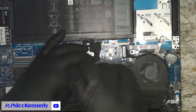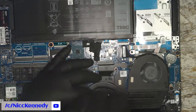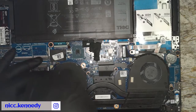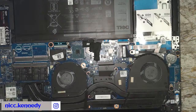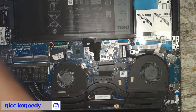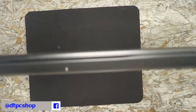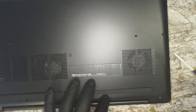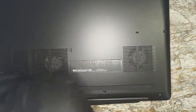Alright, there's our tape. Check all of our screws for the GPU and the CPU. Make sure they're torqued down. You don't need them done with a torque wrench or arm strength or hand strength. Finger strength is good and will hold it. You crank them much tighter, you're going to break them loose, and then you're not cooling your computer very adequately. Same thing back on, set it straight down on, flip it up, squeeze your front shut. You can go for each side, and then the back will kind of pull in once you tighten down these 2 that were retained with the C clips.